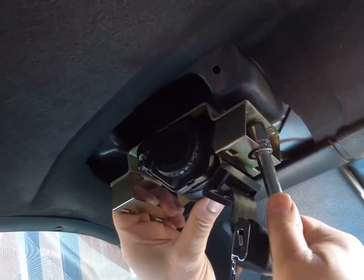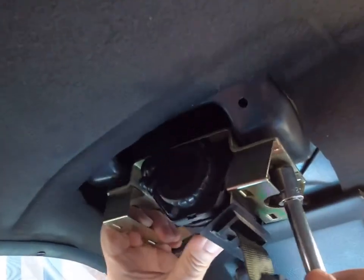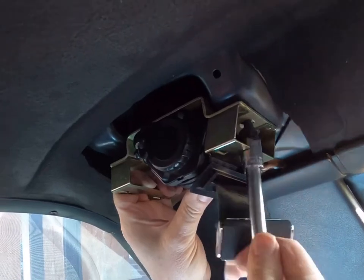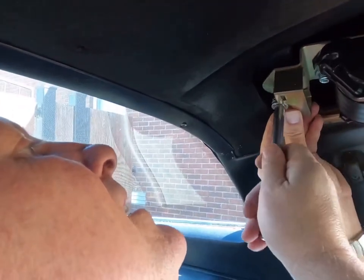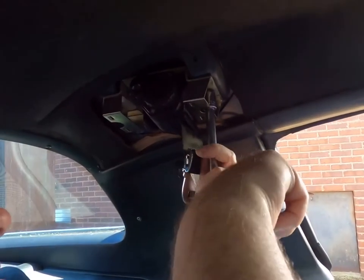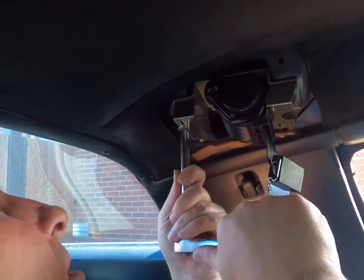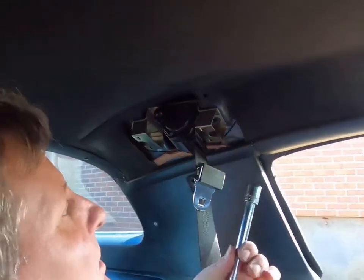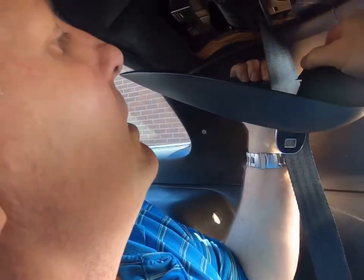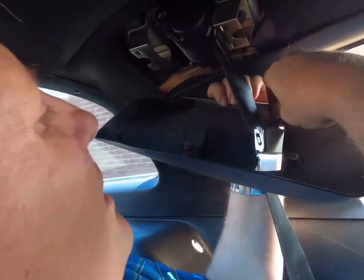Wait for it to click — there we go, it's lined up. When it clicks, you know you're not cross-threading it. Get the other one started. These are going in awful hard. The main thing with these is shear strength, so I'm just snugging these up really good — probably giving them 45 foot pounds of torque or so. And there's that little guide. We're just going to take this and slide it over, being very careful not to nick the new belt. Then pull this over like so.